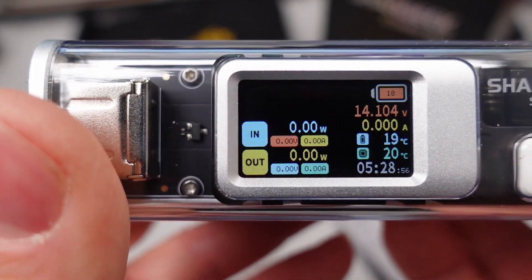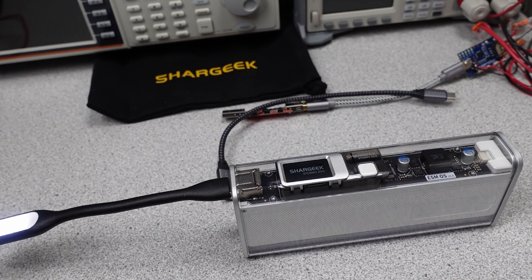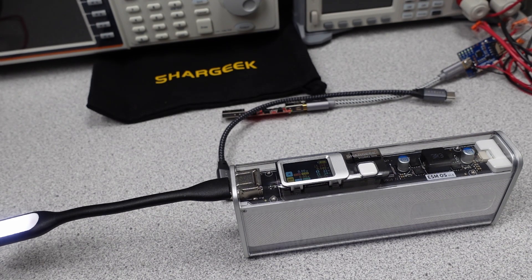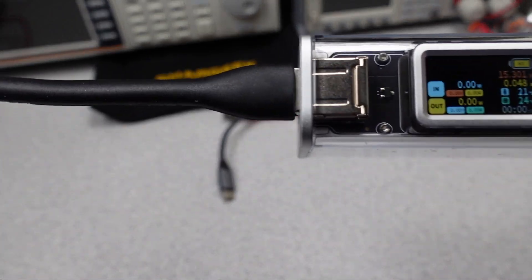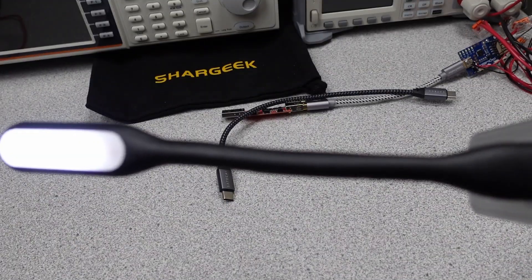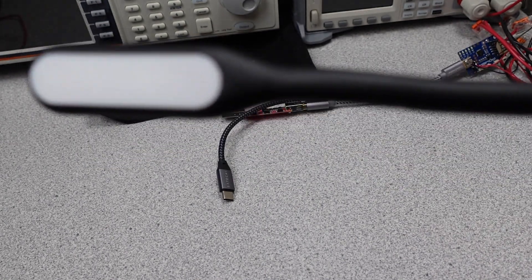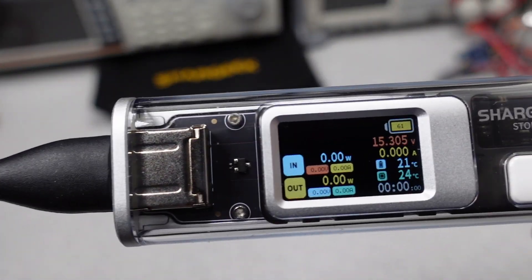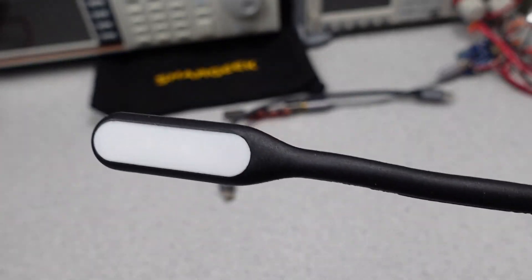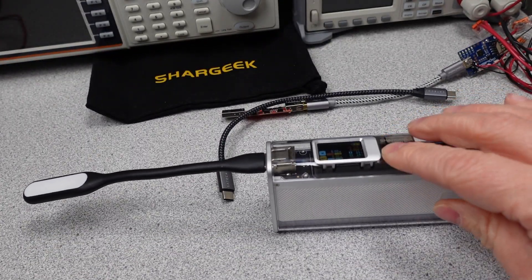The device does not have always-on output voltage. If the load is light enough, the device will turn off the output after a few seconds. There is detection, though, so any new plug-in will turn the device back on. I didn't see any press-and-hold functionality. Pushing the power button again won't wake the port back up either, so you do have to unplug and plug back in. The display stays on, so your battery will drain, but the port shuts off. This doesn't make a lot of sense. This may struggle to charge things like smartwatches, so keep an eye out for that.